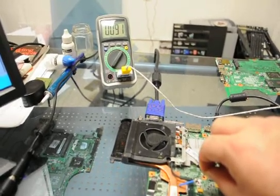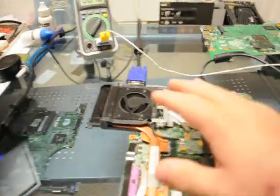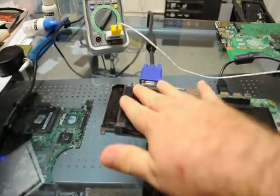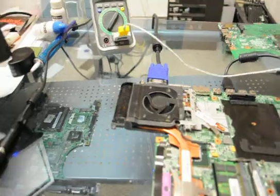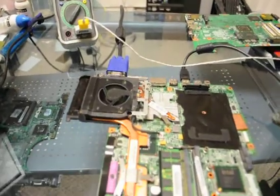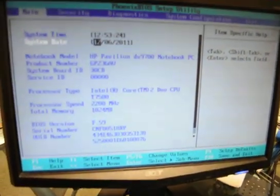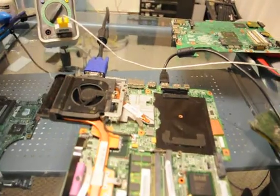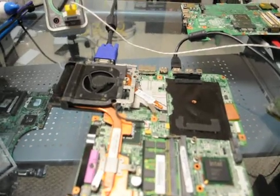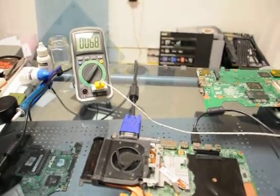So what it's telling us is that the thermal compound is actually pulling heat off of the chipset, and using the heat pipe here, it's heating it up, and then the fan is expelling that heat. We've done this by our probe, and that tells us that our heat set for our thermal compound and the burn-in that we ran for 2 hours, just like the manufacturer specified, worked. For setting this thermal compound, you're supposed to run it for 2 or 3 hours to cure it on the actual processor. That has proven to do what it needs to do.